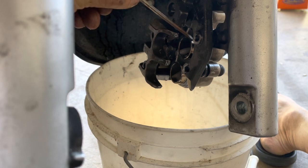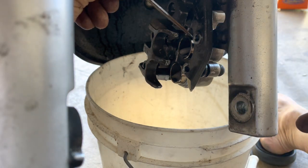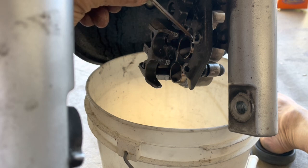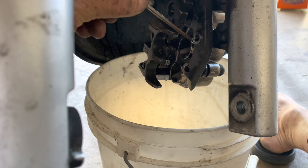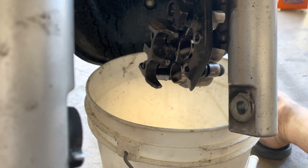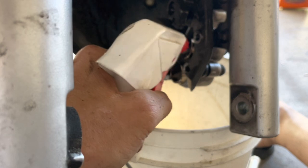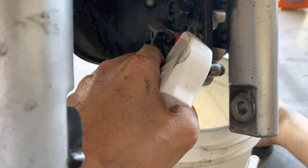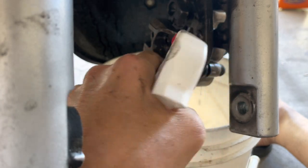So a little bit of something that I saw, it's more visual because I can't feel it. I'm running the flathead screwdriver across that thing on the piston surface. I don't feel anything. Usually if it's a pit or a glob of gunk, you could feel it, but I didn't feel anything. Feels fine. It's probably just tarnish of the material. When I took off my old piston on the Elite, that's what it was. It was just tarnish. There wasn't anything serious.